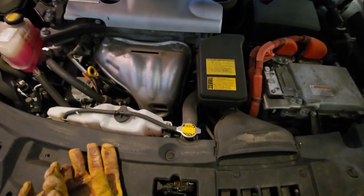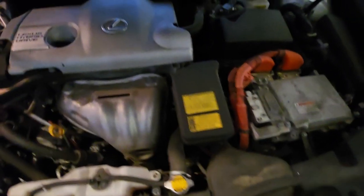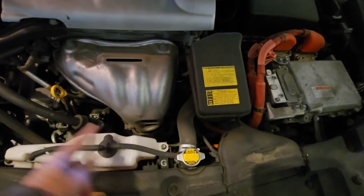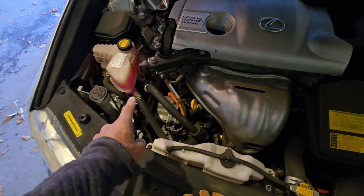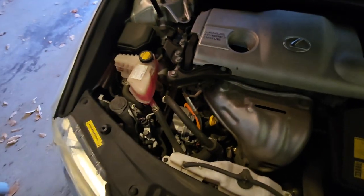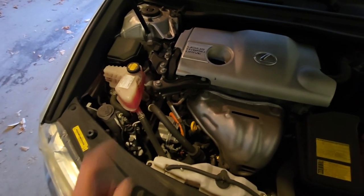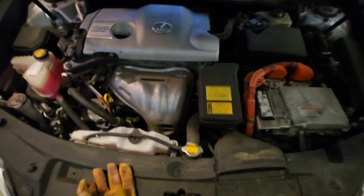I'm going to have to jack this up and try to find, I think, a stopcock for the traditional radiator, which would be the fluid in there. And then I think there isn't a stopcock. There's a 10 millimeter hex head bolt underneath somewhere for that. I have no idea where. I'm going to take that stupid splash guard off and see what happens.